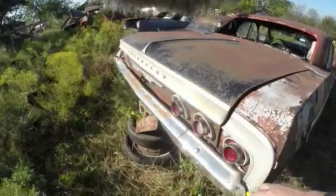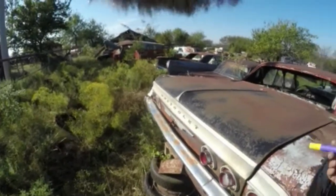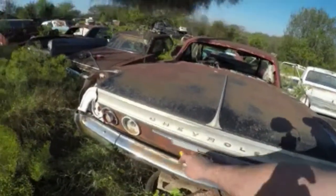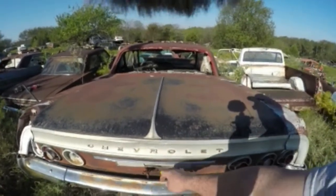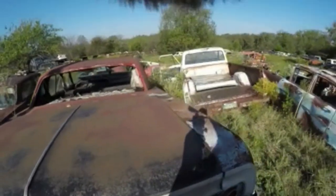As far as trim back here, we're not really gonna know until I take the bumper and all the other stuff off, depends on where we're at. But I know we got that right there. What I'm gonna do is probably go cut this and put a new sheet of metal in there and delete the trunk latch completely, and just have where I can electronically pop it.